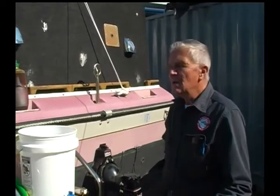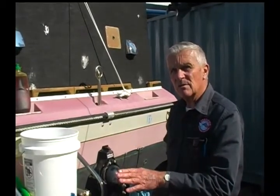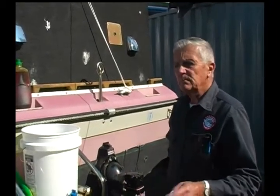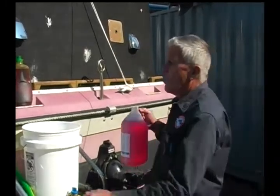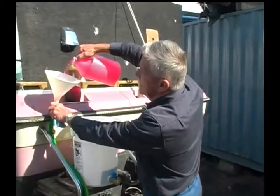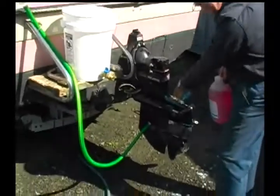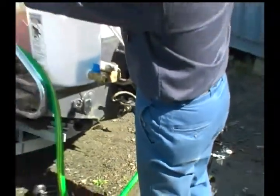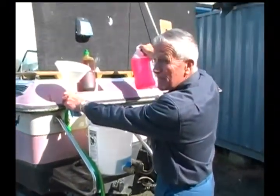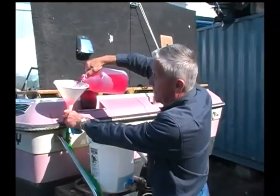With a carburetor, you can actually dribble oil in, but with an electronic fuel injection system, it's a little bit different. Good point. So what one would do then is start pouring here, which would allow the non-toxic fluid to go where the pickup is, down in the lower unit, and as soon as this was full, like so, the other person would start the engine. Once the engine's running, then the person out here would have to keep pouring.